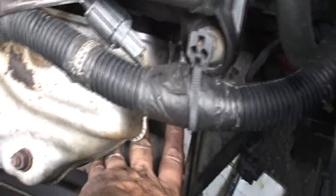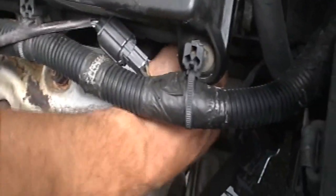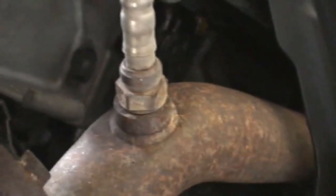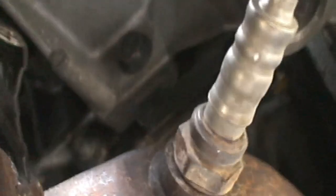There's a couple screws here — two little bolts I'm going to take out to remove this shield here. I've already got most of these things loose for you guys. Here's the O2 sensor I was going to do about right here. This is a 7/8, which yes, I have loosened that as well. There's a bolt there and a bolt there that has to come out.